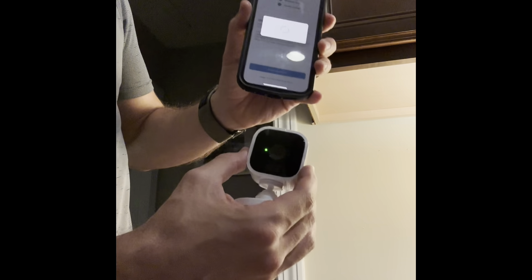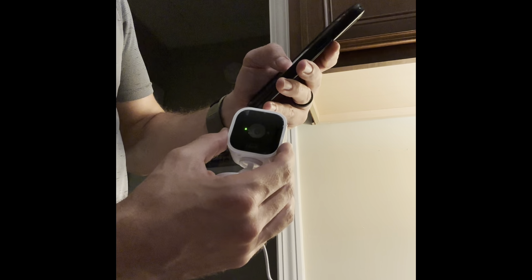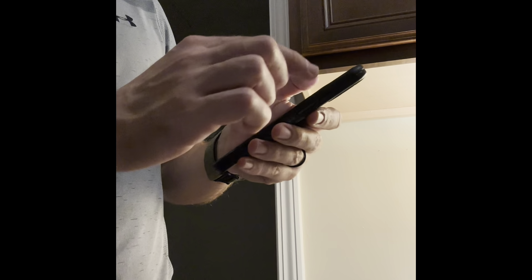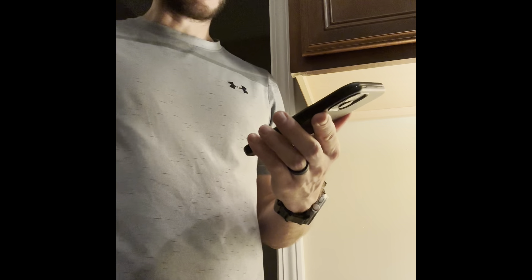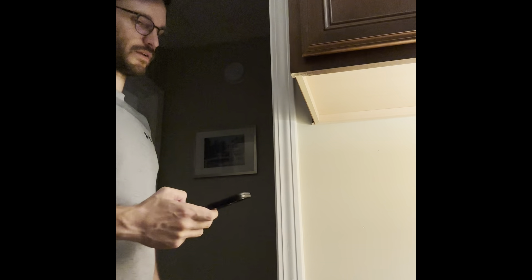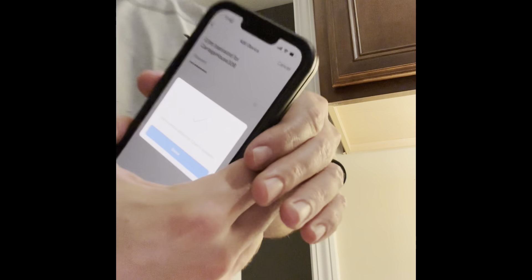It tells me this little device has to be doing the same as what you see in the phone — blinking blue and steady green — which both are occurring. Now you click on 'discovered device.' It says 'Blink wants to join a Wi-Fi network' — click join, because both have to be on the same Wi-Fi network to set them up. It lists your Wi-Fi networks; you have to choose the same network you're currently connected to — for example, if your network is called 'surfer shop,' you connect to that, not to your neighbor's Wi-Fi. Then enter your Wi-Fi password.